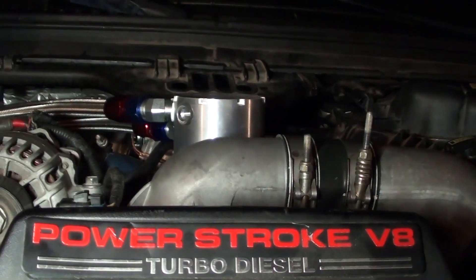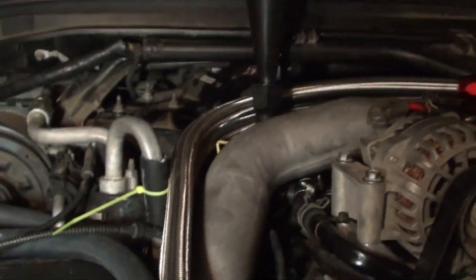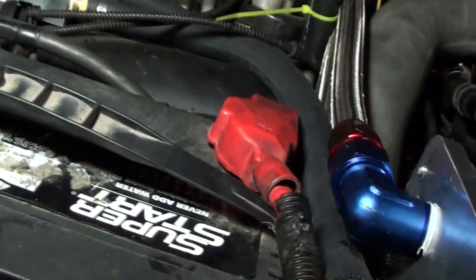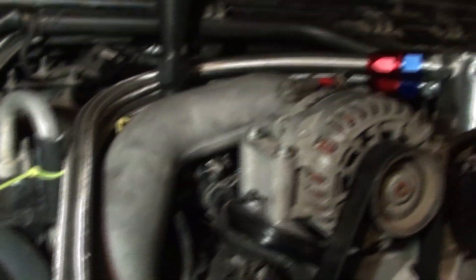Your standard oil changes should be fine after that, because that oil will actually sit in these tubes when you turn the truck off. Same for the coolant - now I've got way more coolant hose because the return comes in underneath the bottle, comes around here in the front, goes over here to the cooler, goes into my coolant filter, and then into the feed right there. I'll probably have to wait until it gets fully warm and then continuously check the bottle.